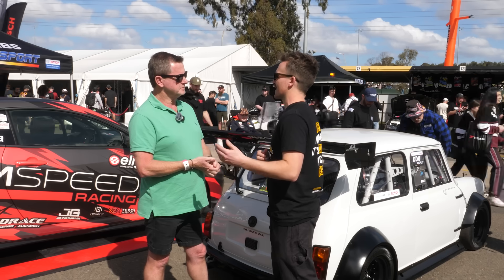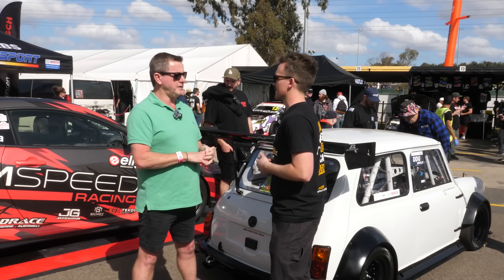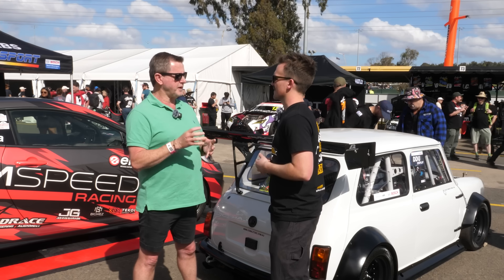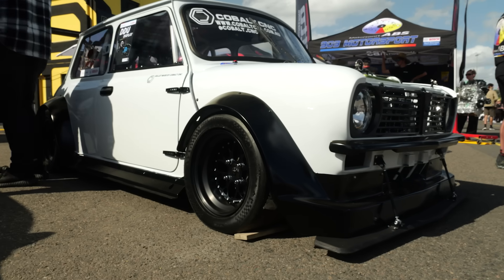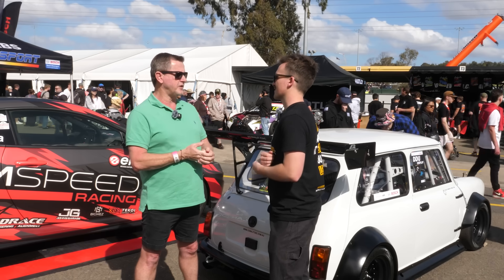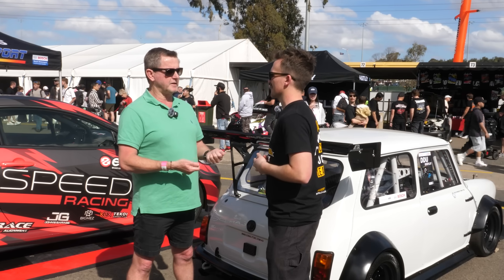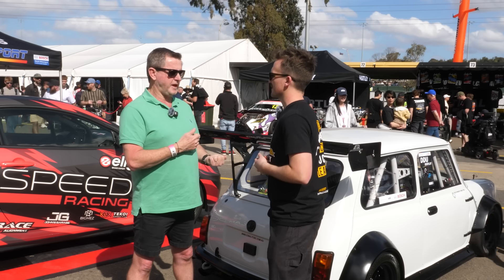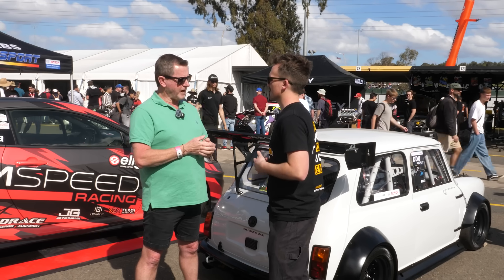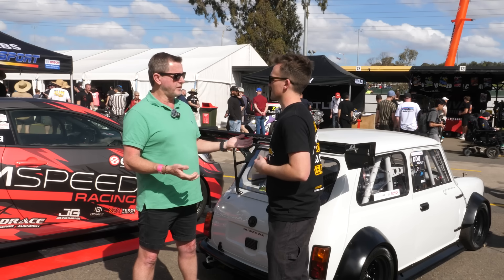The original A-series head is what they call a five-port head — it's not a cross-flow. You end up with siamese ports: two inlet ports feeding four cylinders and three exhaust ports for four cylinders. Very limiting — you can try to flow the hell out of that thing and it won't flow well. You're also limited to eight valves, two valves per cylinder, with a pushrod cam setup. Going to the KAD version gives you twin overhead cams, 16 valves, much better flow, and because it's a cross-flow you can do a lot more with the inlet side.